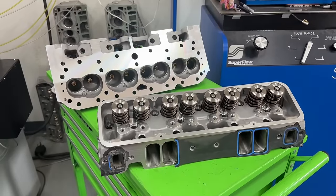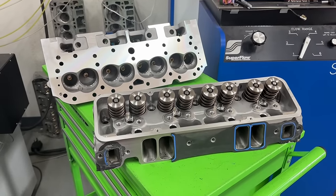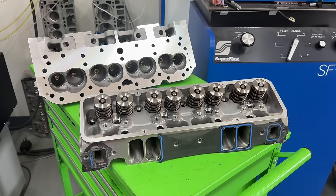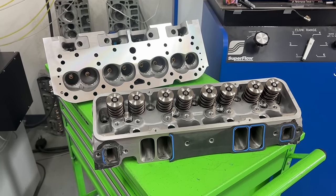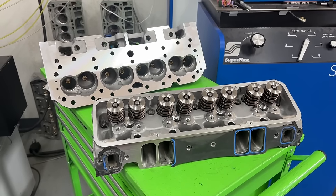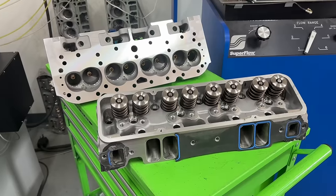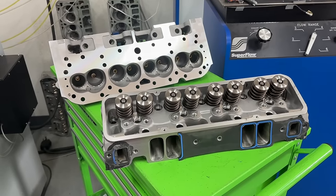The intake manifolds used — there were several. You're going to get to see dyno comparisons between different manifolds, not just one manifold and all three different heads. It had a 1000 CFM race Demon carburetor up top, run on pump gas with a splash of 110 just for safety. It also has a Erson solid roller camshaft: 260 degrees of duration on intake, 270 on exhaust, 108 lobe separation, 685 lift.